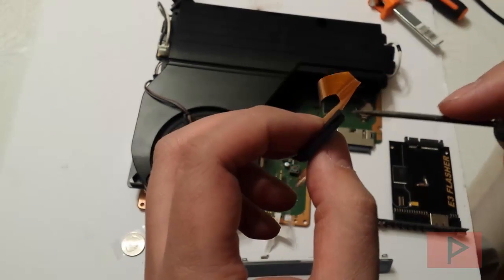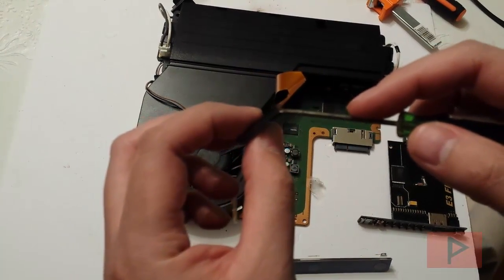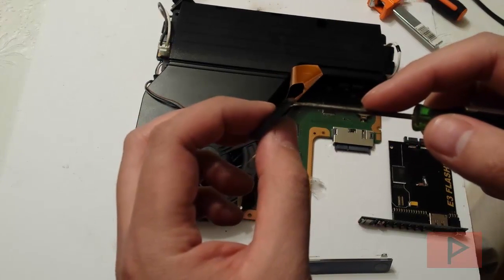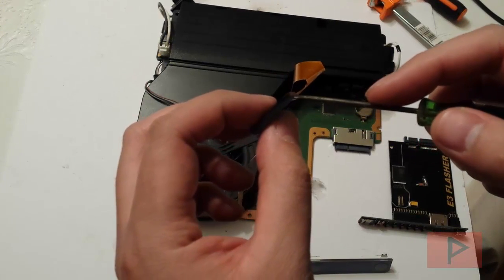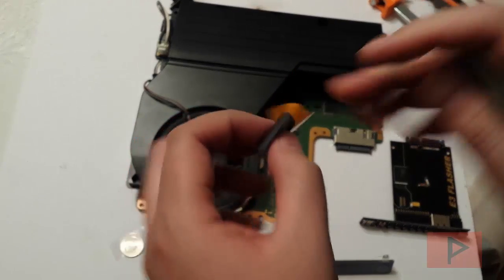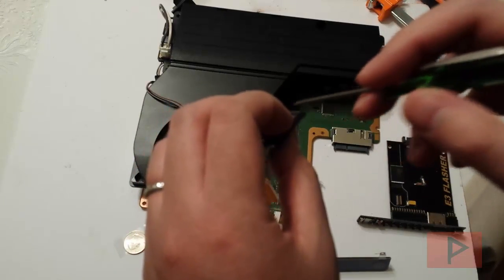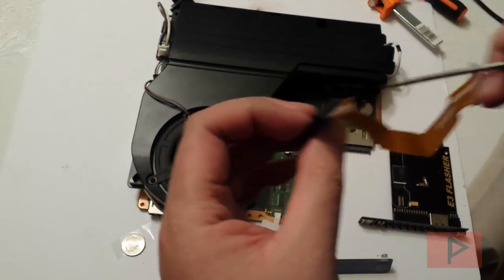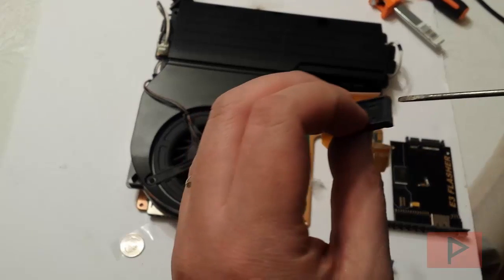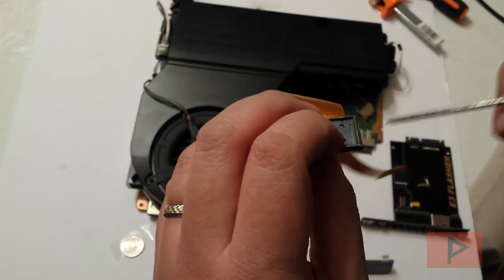Here is what I was talking about with shaving the clip. When you want to shave it, just go from top to bottom — there's like a ridge here, so just shave it down, literally scratch it off with your screwdriver. Do the same thing on the other side. But you don't want to scratch it so much that you actually get inside and damage the internal contact — that is what you do not want to do.